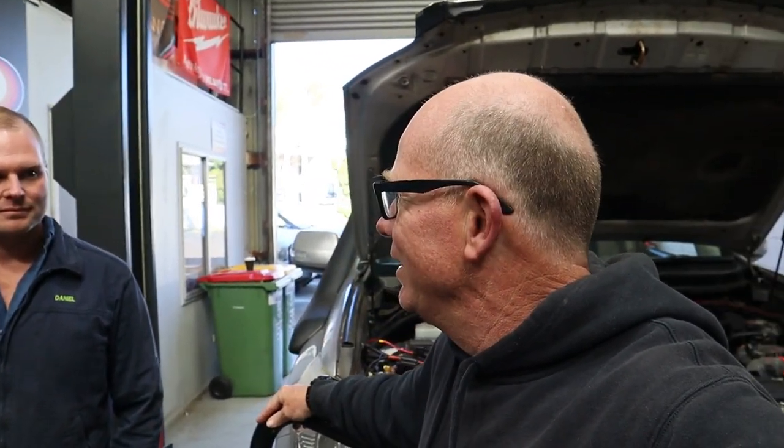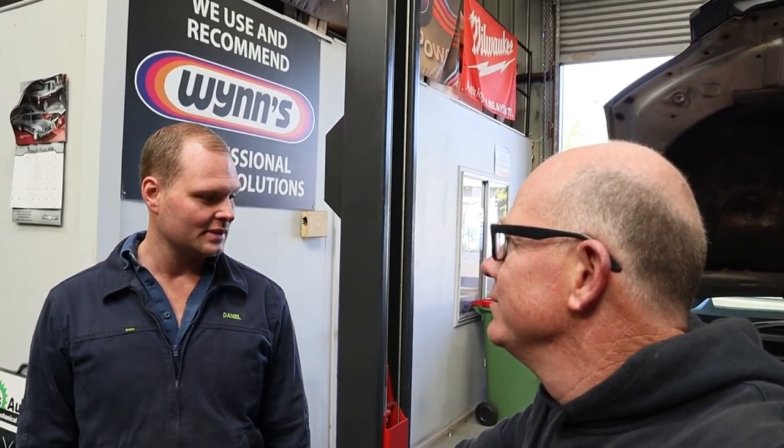Dan, you'll probably give a better explanation on what's going on this morning. What are we doing? We are replacing the clock spring assembly because we've got a failed steering angle sensor. Not all Prados have these, but yours does. The steering angle sensor has failed and it will not allow us to turn traction control off — it's permanently on at the moment. Also we're having issues with selecting low range four-wheel drive, the centre diff locks are doing some weird stuff, and the horn doesn't work when it's straight ahead. There's obviously a failure in there somewhere.